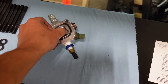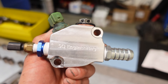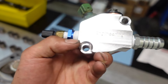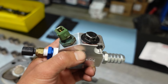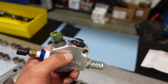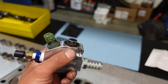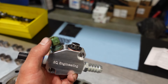But what is this monstrosity? Slimline 16-valve rear head outlet from SQ Engineering. This port and this barb port are NPT. These top two are metric, for either a JDM or a UK application. These size ports actually go on our front water neck, so ignore these two. This oil drain plug bolt just happened to be the right M16 size — these are just to block off the water outlets. I'm not even going to use that sensor.